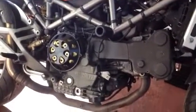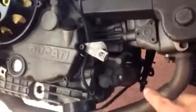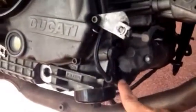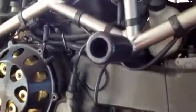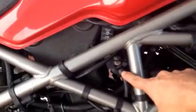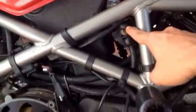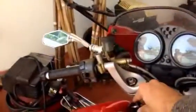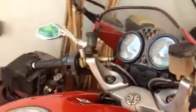I'm having trouble starting my bike. Here's the starter. Here's the positive that goes to the starter solenoid. You're going to hear a clicking sound once you try to start it. The connections are a little bit clean — I haven't removed them and cleaned them completely, though I probably could do that. And here's what happens when I try to start it: turn the key over, it's on, and you hear a clicking sound at the starter solenoid.